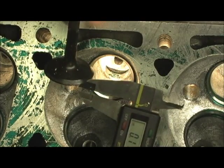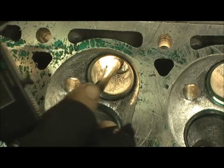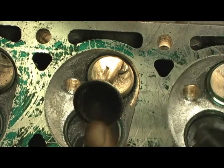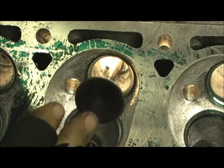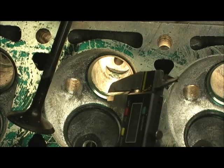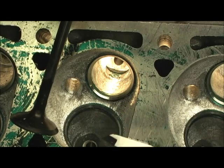The valve job is crapola. Not to mention the valve would barely stick in the guide — it was real tight. I can barely fit it, and I have chamfered them. So all these guides have to be hand-honed to fit the valves going in. The valve job is going to have to be redone because they've got those seats wider than a four-lane highway in Los Angeles. The guides are bad, the valve job's bad.